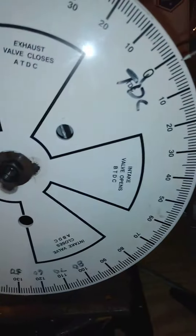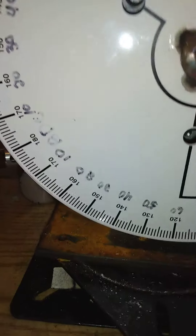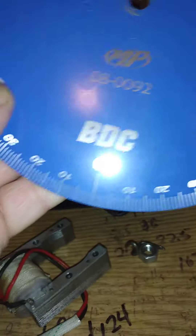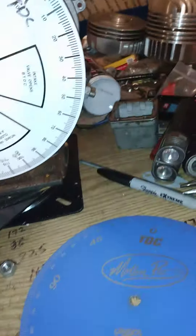The bigger the wheel, the more accurate. This one was originally a four-stroke one, but as you can see, I've marked it — after BDC I start marking them — so it's less confusing. It's just easier to watch. This Motion Pro wheel — I had to open up the inside of it. Sometimes you might need to apply a washer.